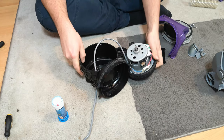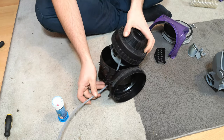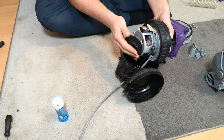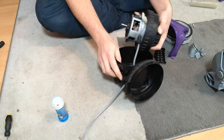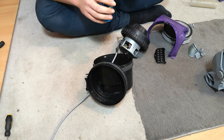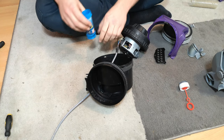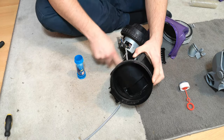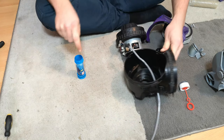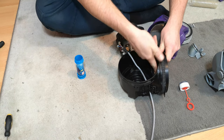You want to keep the wires flowing around the motor so it sits in there and the seal lines up — you need the thick part here and the thinner part there. Pull it back out a bit and coat the inside of the motor housing with a good layer of bubble solution or something similar — it's incredibly slippery for the next bit but then dries fairly innocuously. People use grease in these, but then the next person to have the motor out gets caked in rubbish.